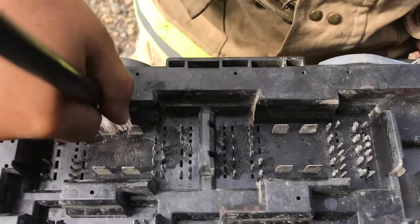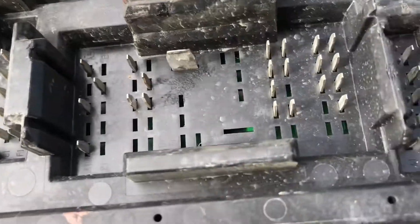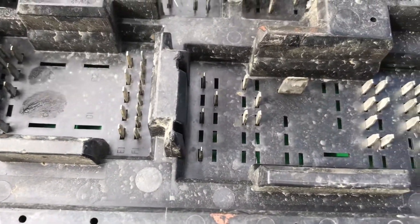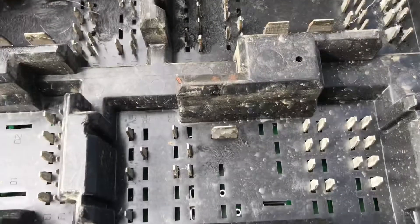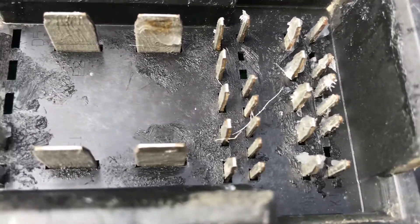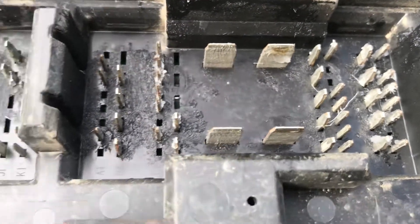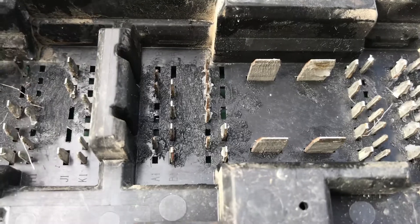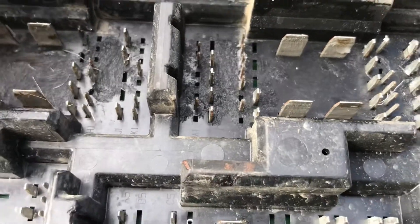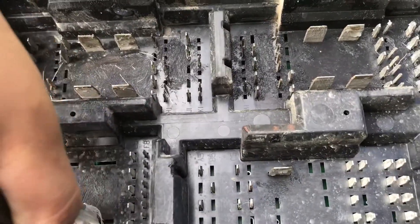Once we got something on there to keep the rest from coming. These plugs all look good — they get that little bit of rust started, or a scratch somewhere, and then that coating that GM puts on there is damaged — that's where the green corrosion will start. So get some of this in there, give it a little longer life. Hopefully get a couple hundred thousand more out of this truck yet.